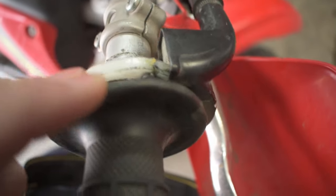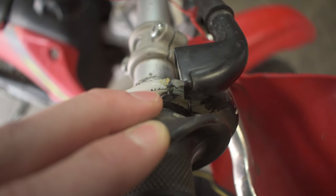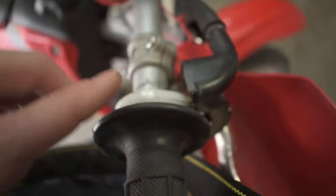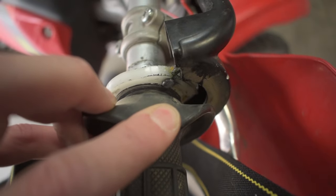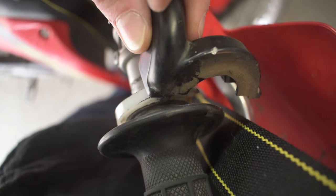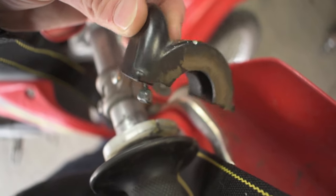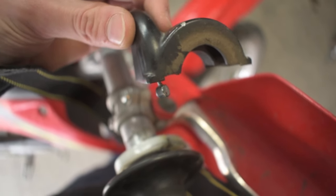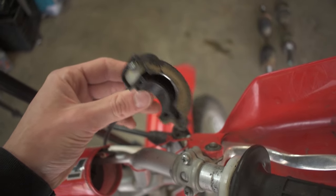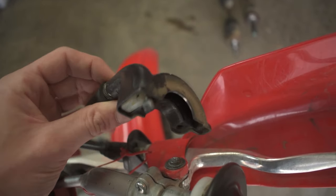After pulling off that exterior cap, if you fold back some of the rubber you can see that piece of metal — that's your actual throttle cable, and that's what attaches the throttle twist to the throttle in the carburetor. To pull it out, grab this piece, pull it off, then slide it toward you and there you go. The throttle cable slid right out with no problem, which is a good sign it's not bound up inside your throttle slide. Now do the same thing with the other half — clean out the inside of the slide and regrease it lightly.